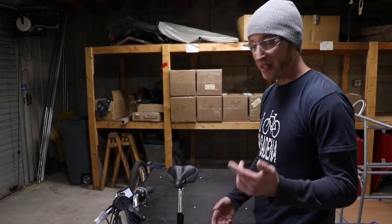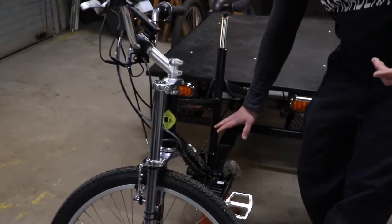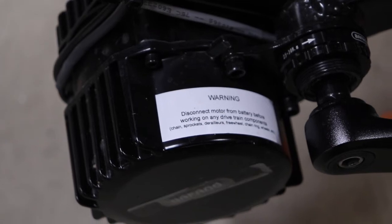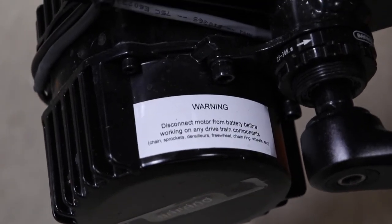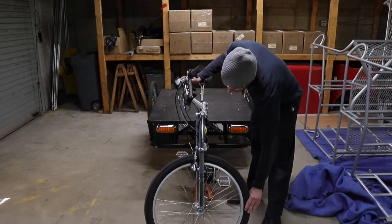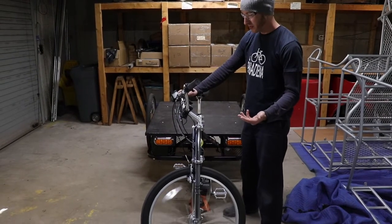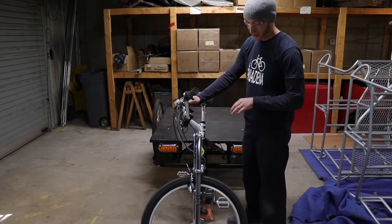Most important safety thing to note is to keep your fingers out of the chain if anything is running. If you're going to do anything to reinstall or service the chain, unplug the battery beforehand. If you're running the motor at all, you do want the front wheel to be turning. That's why it's important to have all 3 wheels raised. This will avoid setting a trouble code with the controller.